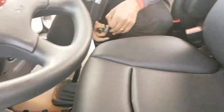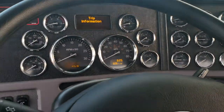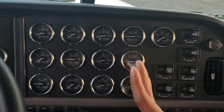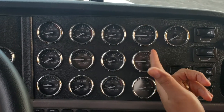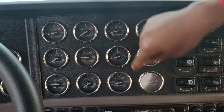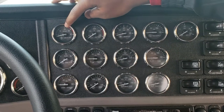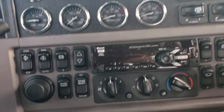In a heavy haul you need a very selective gauge package. Never buy a heavy haul that only has a couple of gauges — there's too much going on. So you have: brake application, suspension, suspension load, front and rear axle temperatures, trailer supply, manifold pressure (your turbo), DEF levels, transmission temperature, pusher axle pressure, oil temperature, air filter restriction, fuel filter restriction, and general air pressure. Every single one of these is important.